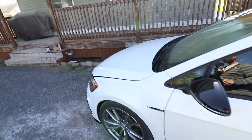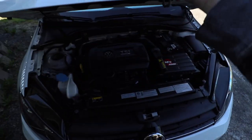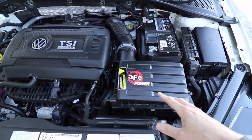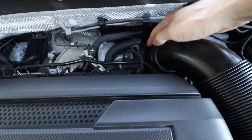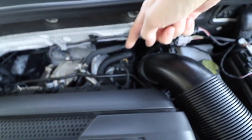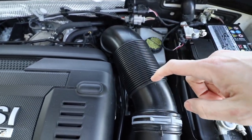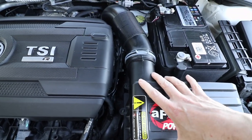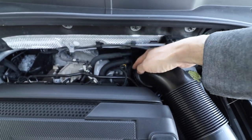Two new things to do: one is installing a part and the other is a modification. What I've previously done is an AFE high flow air filter, the snow guard removal, and the CTS turbo inlet pipe which is down in here. You can barely see it but there's a metal upgraded bigger pipe back there that goes directly into the turbo. This hose here is plastic and it's corrugated, so it's really turbulent for the air. Everything comes in through here fairly smooth through a nice free-flowing air box, and then this jumbles up all the air before it tries to go smoothly into that turbo inlet pipe.